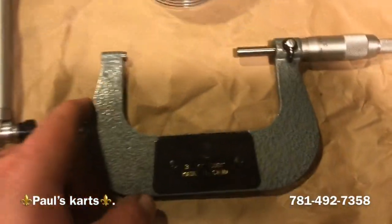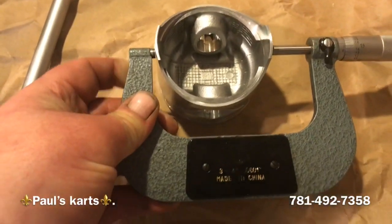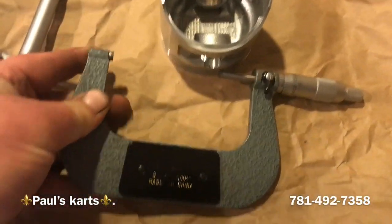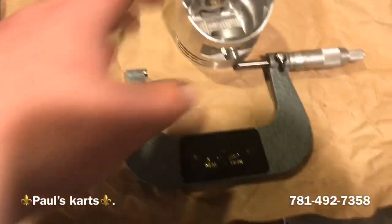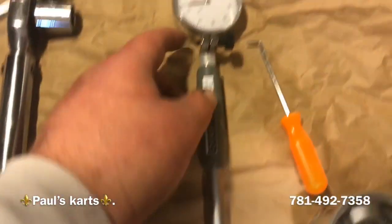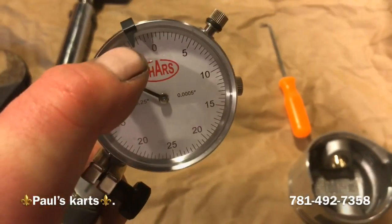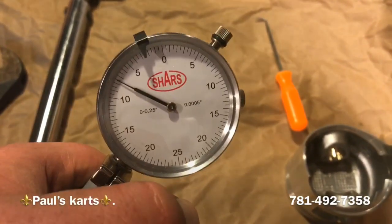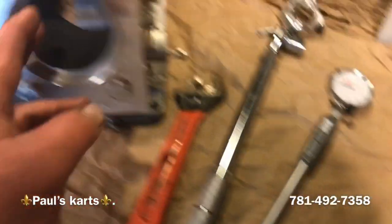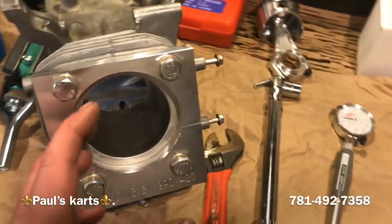After that, you take your micrometer and you measure your new piston. You need to get a feel for it — when you get the piston to the right size, it's going to have just a little rub. After you get the micrometer to that size, you can then take and set up your dial bore gauge with it. Once you get that set up, you bring that to zero — get it to read zero at the size that the piston is. Then I just set my gauge at 2.5 thousandths bigger than that, and that is going to be my gauge for when I am boring out this block to ten-thousandths over. This is a ten-thousandths oversized piston, so this is all relative when you're straightening bores.